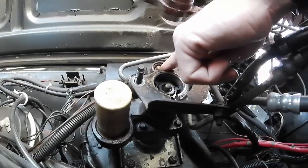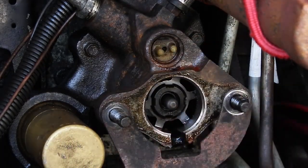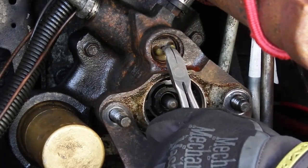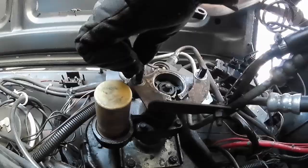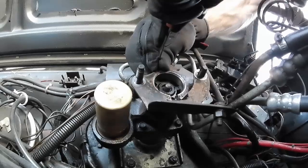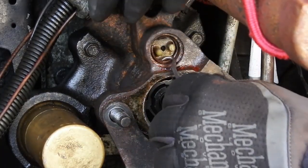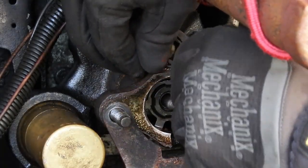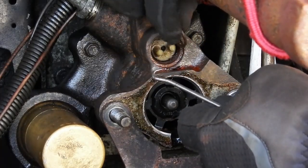We're going to take this and push it in, and there's a little C-clip in there that we've got to pull out, and then this should slide out — it's probably going to make a mess. First thing I want to do is see how much spring pressure is on this thing. I pushed it in and it stayed in. Once you start getting it out of that channel, maybe you can pry behind it. I'm using this backwards pick tool to pick it out, and it's coming out little by little. A little hard with big gloves on, but we got it out.